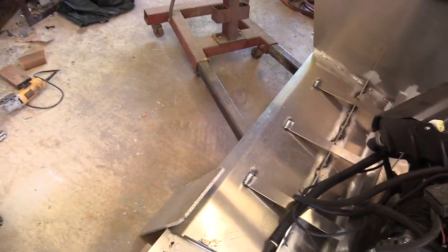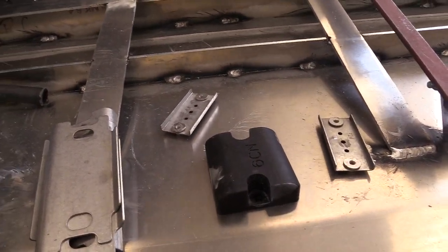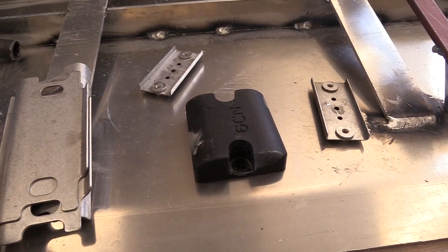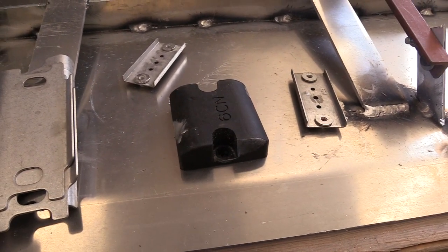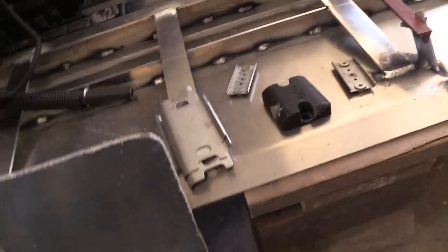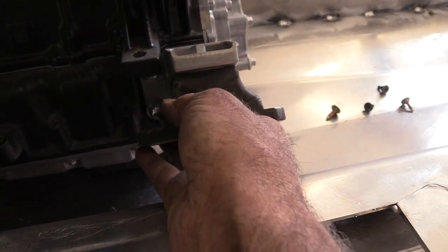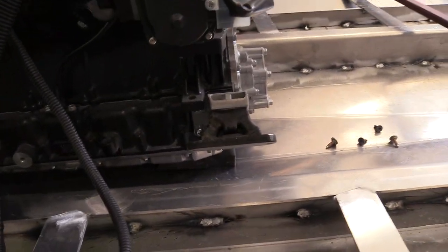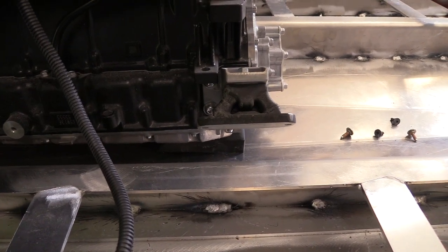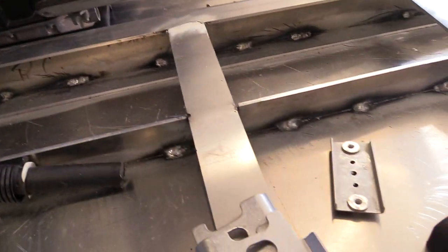The other thing I figured out was that these rubber pads — they're hard rubber — they go in the cups on the oil pan and they appear to be what bears the load of the engine. Being as hard as they are, these appear to be more like stabilizers, vibration absorbers — they keep the engine set level and take the torque of the engine and absorb it.